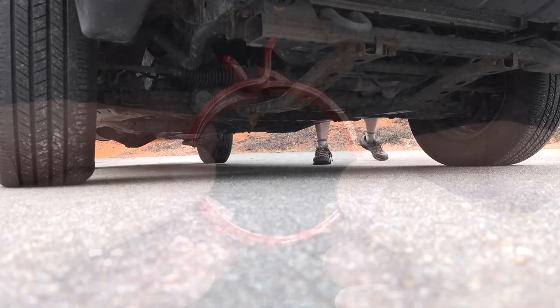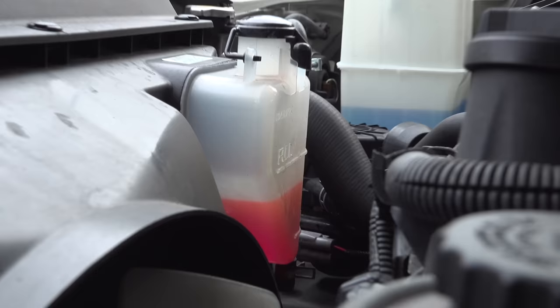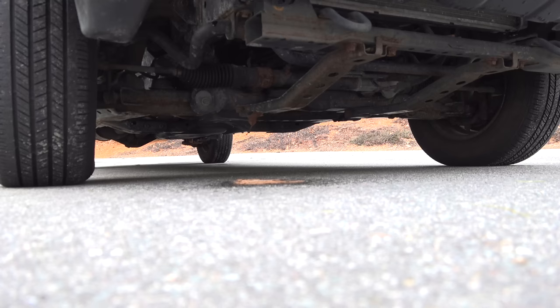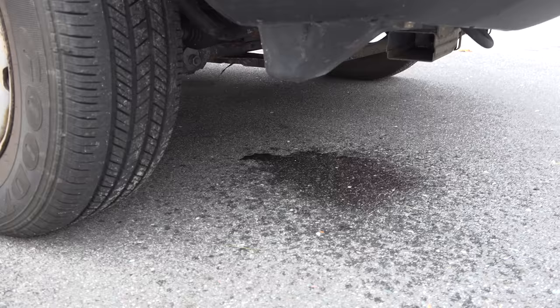Here's a perfect example of why you should never use those old style clamps on any type of vehicle. This is my 05 Tacoma, and I began having a problem where every month I kept having to add coolant. I never saw any leaks until one cold morning when I started up the engine — coolant was pouring out of the front. I thought it might be the radiator cracked, but to make it even more strange, after about a minute of the truck running, the leak had stopped.